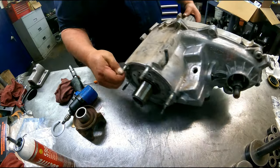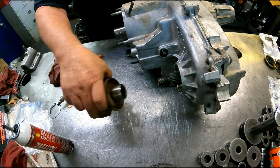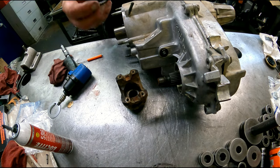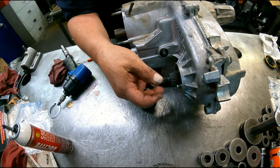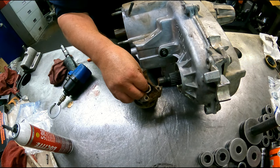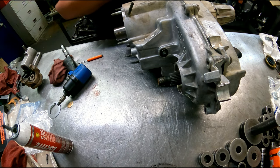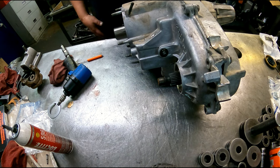Okay, just in case I'm not able to put this on camera, after I put the seal in, the flange goes in. And there's this rubber seal that's got to fit into the grooves right there and go up around there and seal that. Then we have our nut. We're going to Loctite it in place. Inch and an eighth on that.